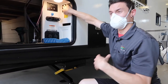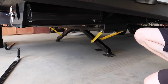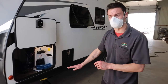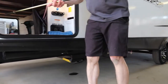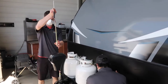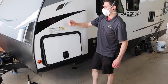You'll hear the motor change sound slightly when the jack touches down — that's your cue to stop. The same applies to the back jacks: always make sure the feet are going to land flat, look around to make sure you're not landing on anything you don't want to, and as soon as one foot touches down the next one will come. This other bar here is for your front tongue jack — just in case you don't have power, you pull out this rubber plug, put this bar in here, and you can operate the tongue jack up and down manually.